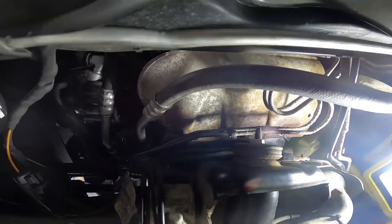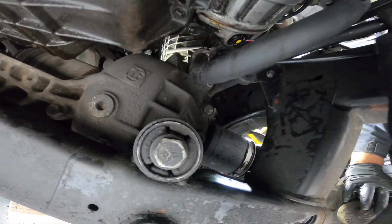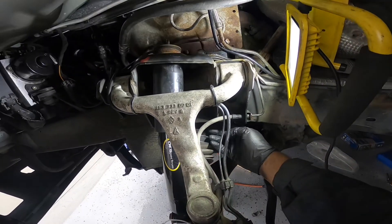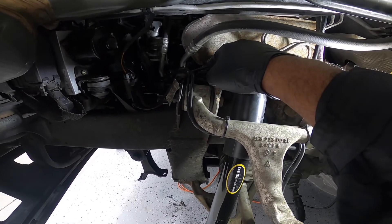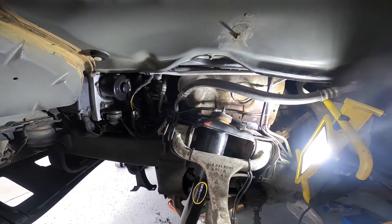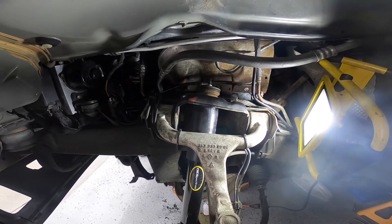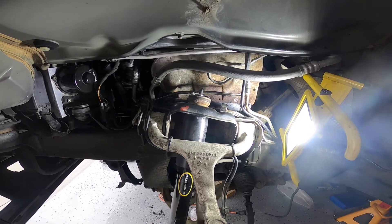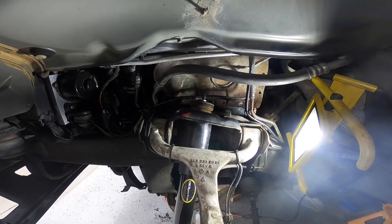To line them up, just get under the car and line them up from the front — you've got a better view from there. Once you put one bolt in, the other two will follow suit. Make sure you've tightened the two nuts down the bottom, one top nut with the 18mm up top. Once all that is secure, just put your wheel well liner on, the wheel on, and the driver side motor mount job is done. Thanks for watching — questions in the comments below, and please subscribe!